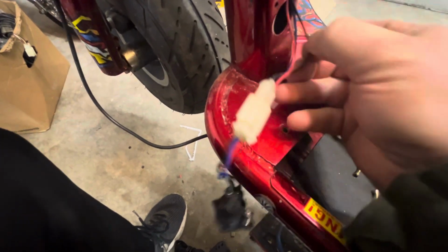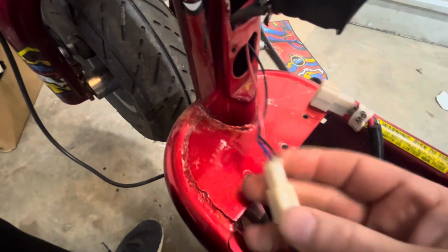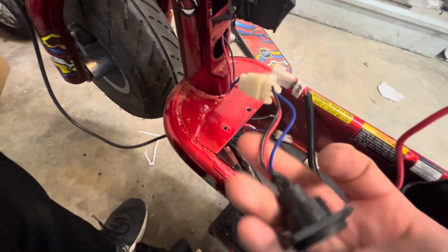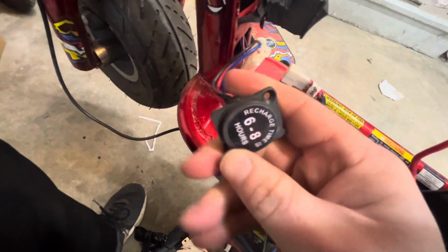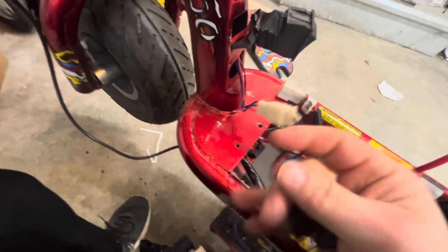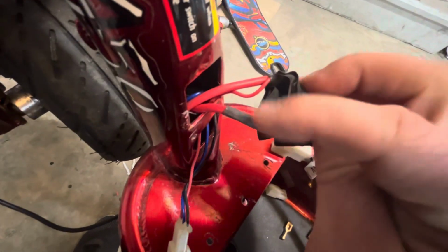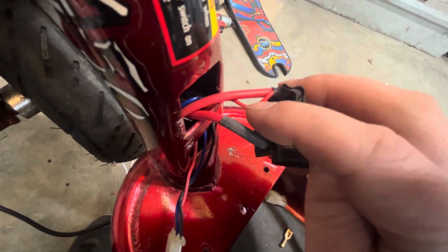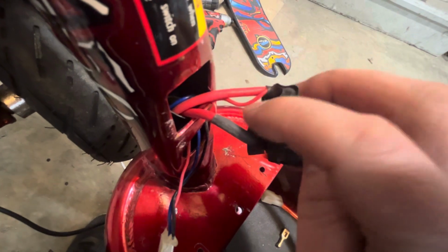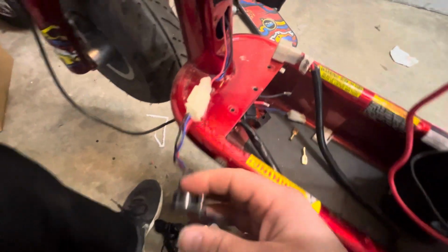and it comes out of the right there and goes into this pigtail, and then into this pigtail over to here, this is the charger. I think I can open it with one hand. The charging port. So the positive actually comes from right here. So you got positive in or out, or vice versa. Actually positive in, probably out, and then this is the wire they piggybacked off of that. That comes down to here for the charger. So that's where those all come from.